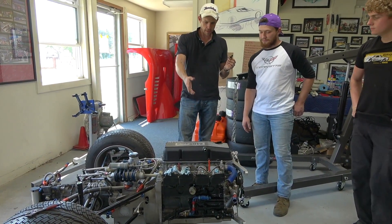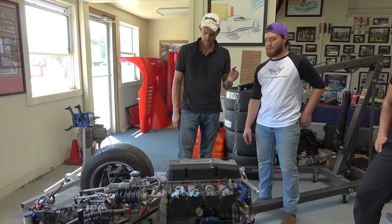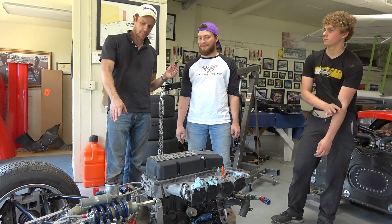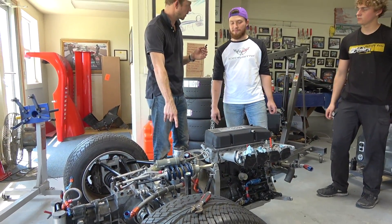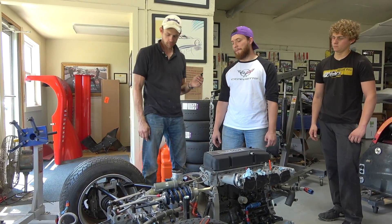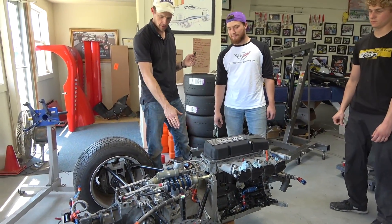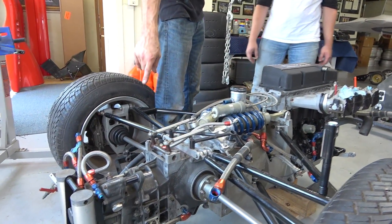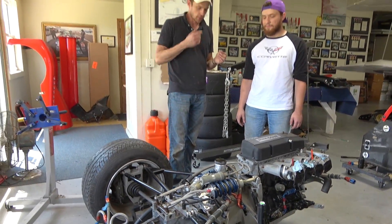This one is set up with dry sump and individual throttle bodies, and all the internals have been built with forged components. You've got your stress transaxle, and the dry sump oil tank in the middle — which is really interesting because it's like a tunnel, like an IndyCar. You've got an elongated input shaft, obviously your clutch, then it goes to the center of the oil tank, and then you have your transaxle at the back — a Staff transaxle. All really good racing stuff, like AP calipers.